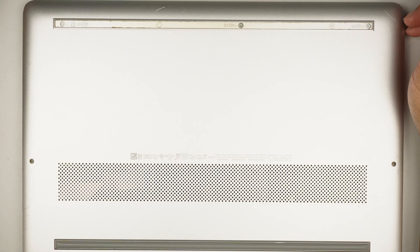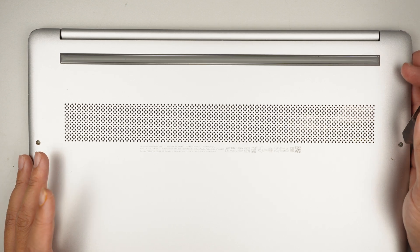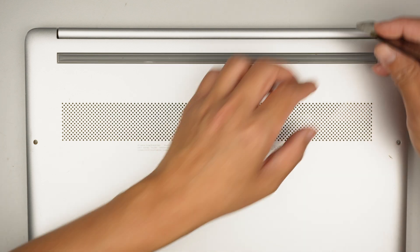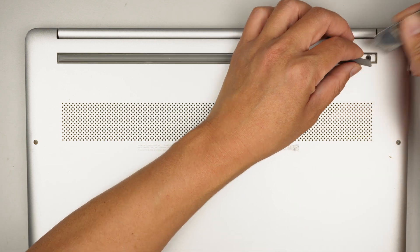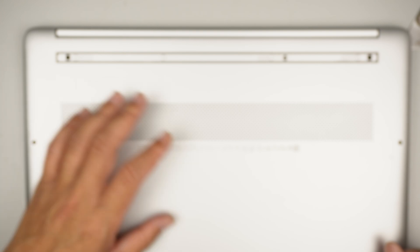Let's go ahead and turn off the computer. That is the laptop — the model is the HP 15DY2073DX. If you have a different HP laptop that's fine; hopefully if it's somewhat the same model you can follow along. That error code definitely indicates that the CPU fan needs to be replaced.